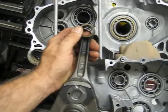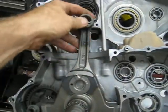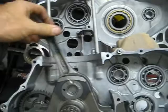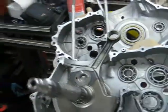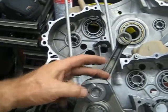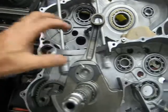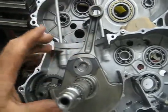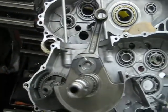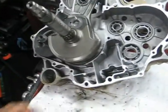The crank is actually in good shape — it doesn't have any play up and down. You can see I'm pulling on it but it's not moving. They will move side to side, which doesn't matter. You really want to grab it and pull it straight up and down. If it has any play, I suggest replacing it. The roller bearings in here wear out and you have to replace the whole crank. You can get a rod put in, but by the time you pay for the rod and labor, a new crank isn't a whole lot more.